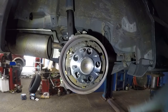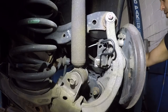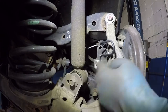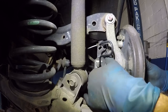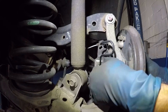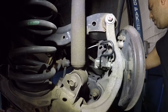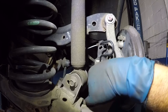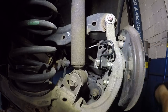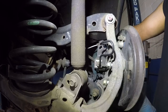Put the drum on, clean and adjust the brakes — it's all up to you. I'm back here at the bearing hub assembly. Since we took off the hard bolt last, it's a good idea to put that one in first — it'll hold everything in position. Try to get that one first because it's the easiest to see. Then put all the other bolts in and snug them.